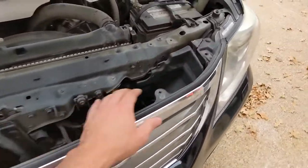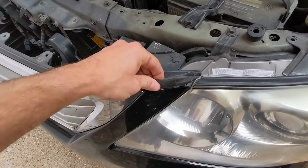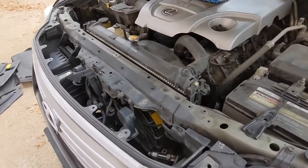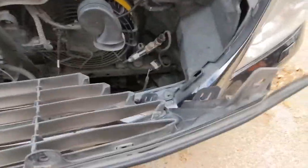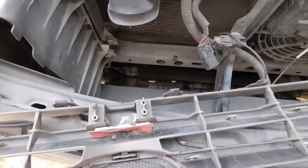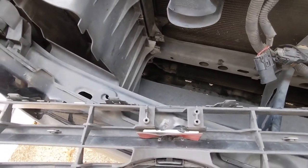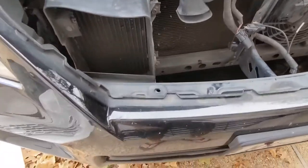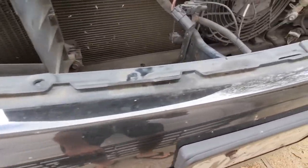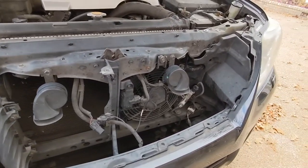The top part of the grille is loose. Next thing I'm going to do is pull this weather stripping out — gently pull it across the top edge, and it's out. The side clips were real easy. The only ones that gave me trouble were the bottom ones. You can reach the two outside ones on each side, but the two middle ones were real hard to reach. I had to get a short stubby flat head, or you can use a pick, to get those clips to release and then pull it out. Don't yank on it too much, because you don't want to break the points in the actual plastic bumper where the clips go — then you won't be able to put the new one on.